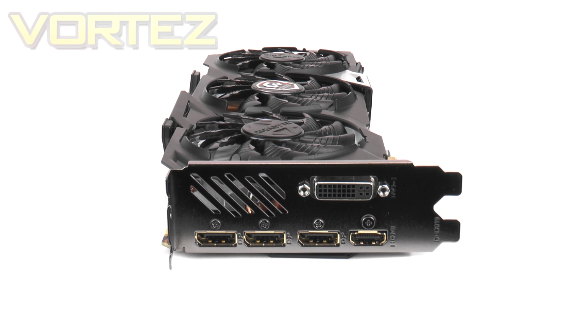Now Xtreme is also PCI Express 3.0 compliant and is DirectX 12 ready. Xtreme will occupy 2 spaces on your board and your case, so make sure that you do have enough room there. And on the back panel here we have a generous selection of ports available, all of which are gold plated. So included here we have one DVI-I giving you up to 3K, triple DisplayPort 1.2s each giving you their 4K at 60Hz, and one HDMI 2.0 which also provides you with 4K at 60 Hz. So quite a lot of selection there, quite a nice choice if you're perhaps wanting to use this card for multi-display configurations, as that is quite a popular pursuit nowadays.